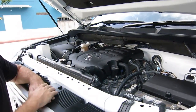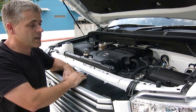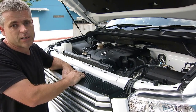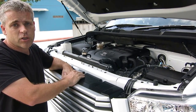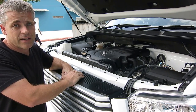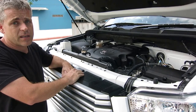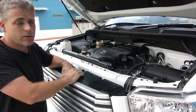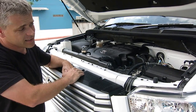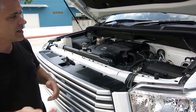The vehicle is fitted with a Toyota Land Cruiser power steering unit. It's a complete bolt-in, as the Tundra and the Land Cruiser share common mounting points, so it mounts very, very nicely into this vehicle. We've had to machine some adapters on the end of the rack to take the original Toyota Tundra rack ends. Other than that, it's been a bolt-in conversion when it comes to steering - nice and simple.